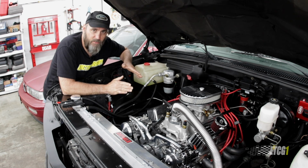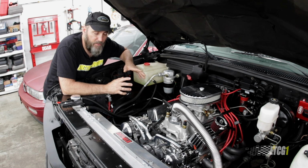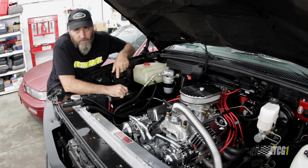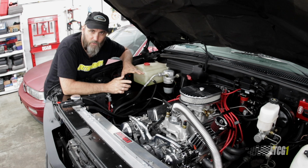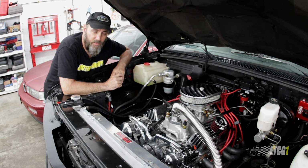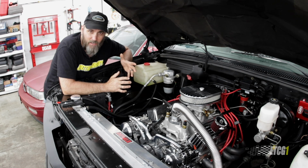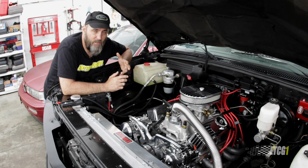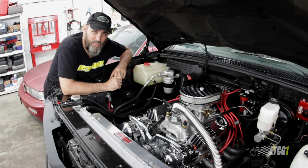Before I pulled the engine the first time to do the flex plate bolts, I did a compression test and found that compression on cylinder number 7, which is the one back there, was lower than the rest. Most were 150, I think one was like 140, 145, but number 7 was 130, and I think that's where I'm going to find my problem. As far as doing a leak down test, I really don't think that's necessary, because what I'm about to show you, to me, verifies that there is compression getting past the piston down into the crankcase, overpressurizing it, aggravating oil leaks and causing my engine not to run as good as it can.